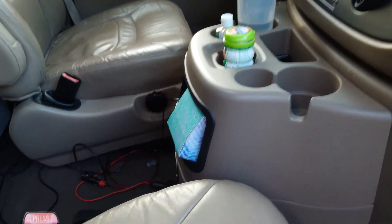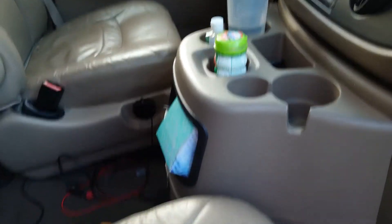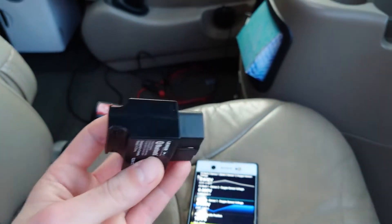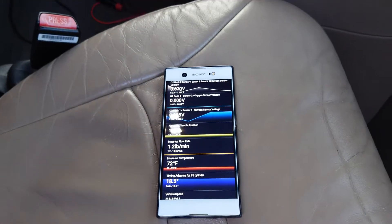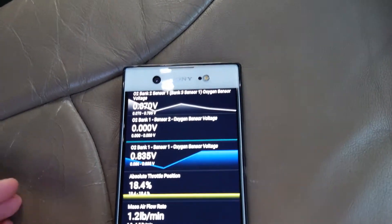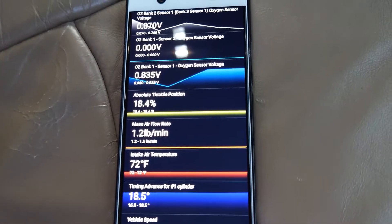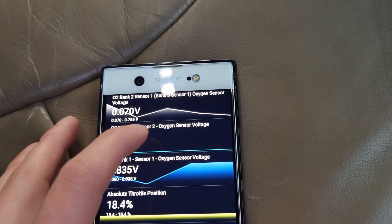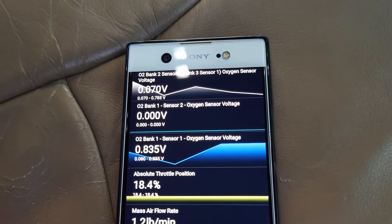In this video I'm going to show you how to replace an oxygen sensor. I was noticing that this van was idling pretty rough, so I plugged in one of these OBD2 scan tools - this is the Blue Driver, it's like a hundred bucks off Amazon. Very handy for running codes on the fly, but I wasn't getting an engine code, had no engine light or anything. So I looked at my live data, and I noticed right here this O2 Bank 1 Sensor 2, oxygen sensor, shows no voltage.